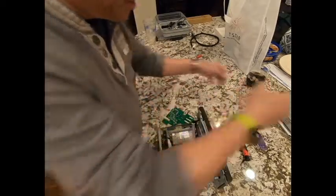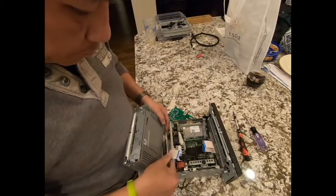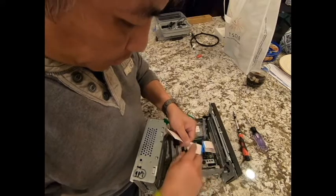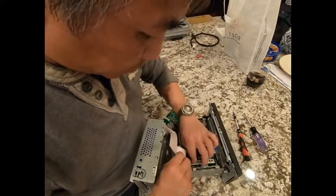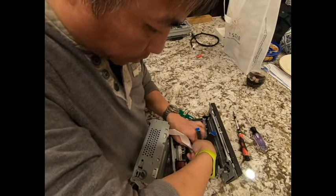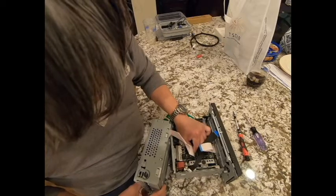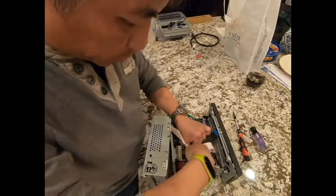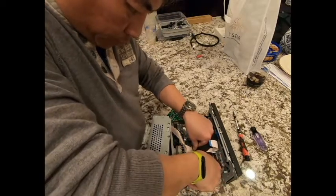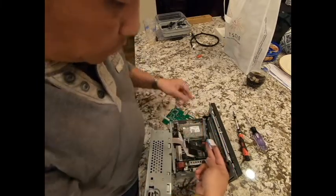All right. And this one's the cable from the DVD. You want to go ahead and plug it in and just lay it on the side. I know there's not a lot of room, but you just have to be careful in every step. If you don't do this now, it's very likely that there's not enough room for a DVD. Make sure it sits in there perfectly. Push it down to lock it in place. All right, now you have 4 of these cables laying around.